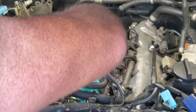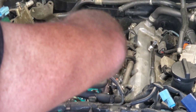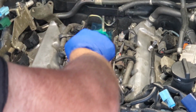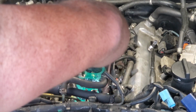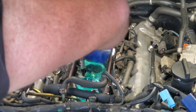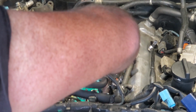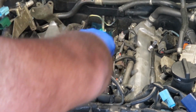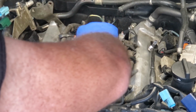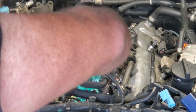Now I'm turning a little over a turn clockwise, and I'm going back half a turn to clean out these threads. I just don't want to push any debris into the nice, fresh threads that we're cutting. And if there was no hole on the bottom here, we'd have to go so many turns, take it out, vacuum out the shavings, and lather, rinse, repeat as required.